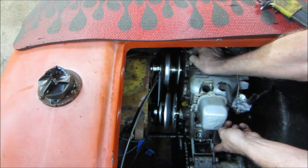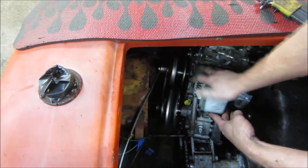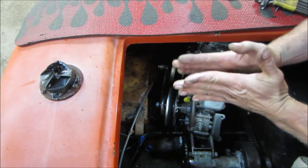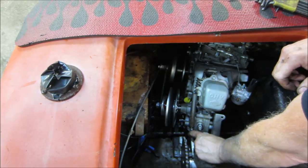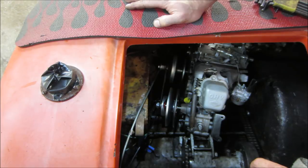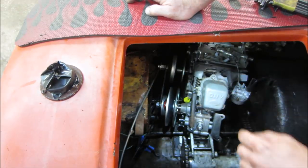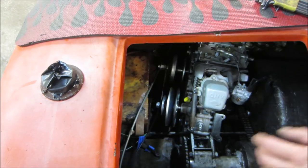And then we could probably come back to the jack shaft here so that the energy, like we talked about earlier, between the sprocket and this will have something opposing it. Instead of the chain just trying to pull it together, it'll be literally mounted right next to it for support. I think that should work out pretty good. But I think for now, what we can do is take it back out of there and make that gearbox some permanent bracketry going to the engine. I think we have enough to move forward with that. We have a plan, a viable plan.